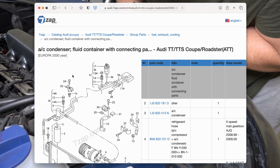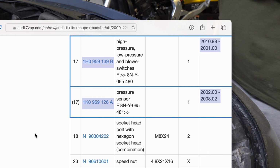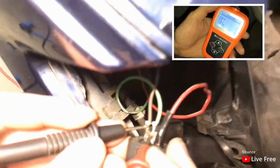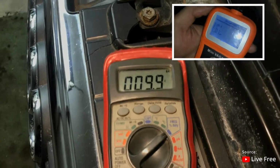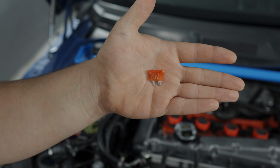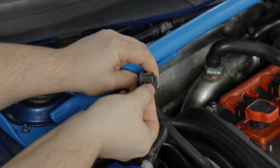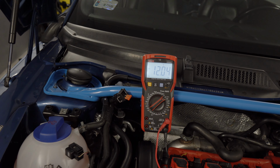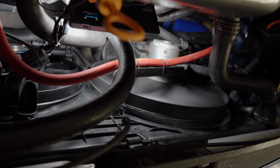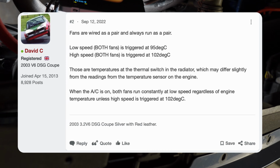It's worth mentioning that after 2001, this sensor was replaced by the G65, which performs the same function but works in a slightly different way, as instead of simple wire closing, it sends a duty cycle signal. I don't have this sensor, so if you want to diagnose it, I refer you to the video included in the description. As for the F129, shorting the lower left and right pins sends a signal to the fan controller to activate both fans on the first gear, while the upper left and right pins are responsible for engaging the compressor clutch. In my case, forcing the first gear of the fans only caused one of them to spin. This is another problem to solve because the fans should always rotate together.